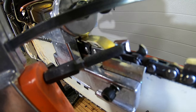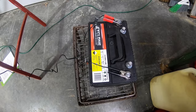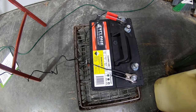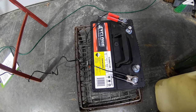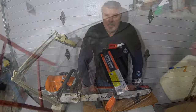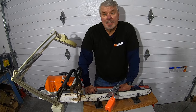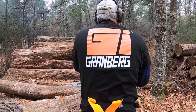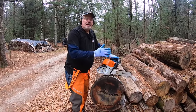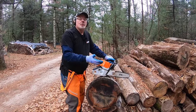There's the finished sharpening. As you can see, it goes all the way up the gullet, the full radius, all the way to the tip. The unit comes with two alligator clips, and we just hook it to a standard 12-volt battery. You could use your solar charger or some of the jump packs available out there. Now that we've finished sharpening both sides, let's go outside and give it a try on a piece of wood to see how well we sharpened it. The saw has already been started and warmed up a bit, so let's do some cutting.